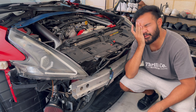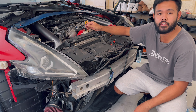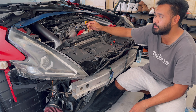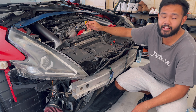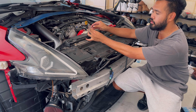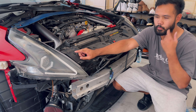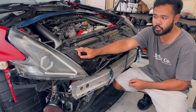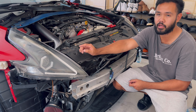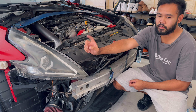I'm redoing the wiring. I had to cut this because I didn't read the wiring diagram. What I did was put all three wires together — don't do that. I need to wire this straight to the battery; these two go on either side. I had the LED strip and it wasn't turning on, but they do work, so it's the wiring connection from the LED strip into the park light wires.